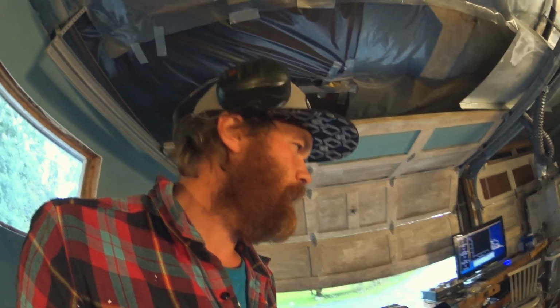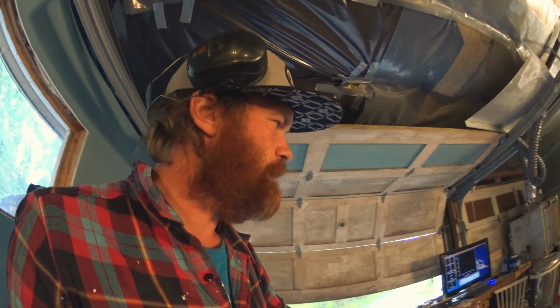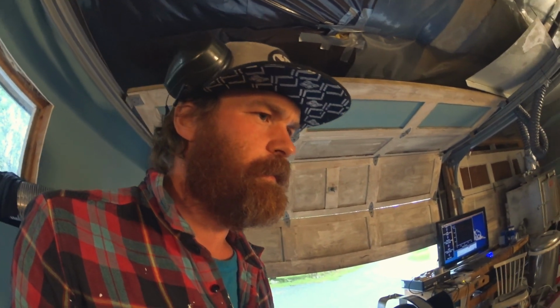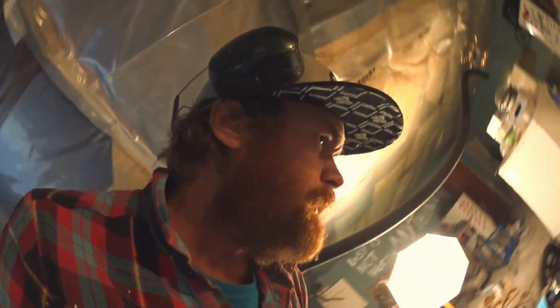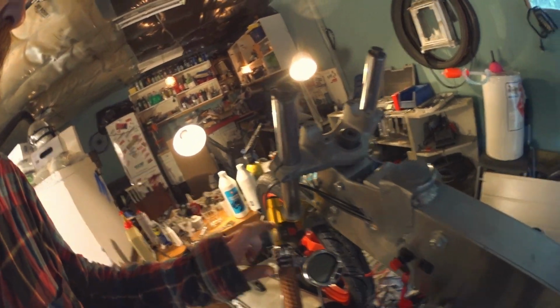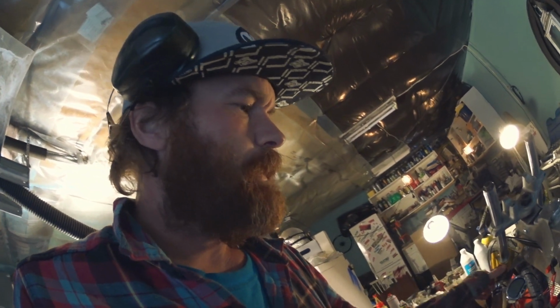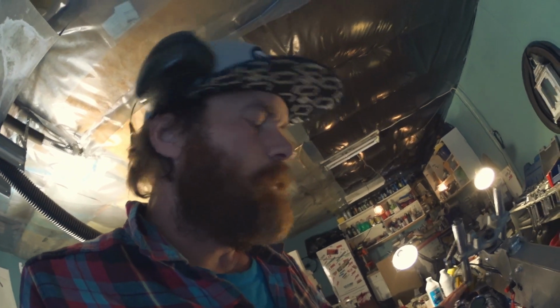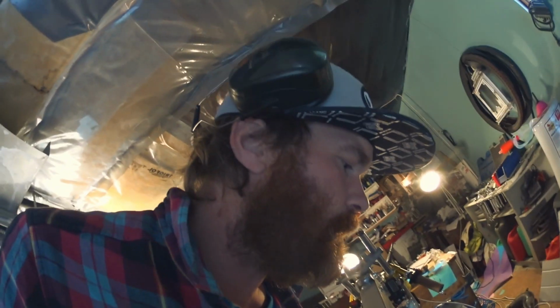Yes, I'm crossing my fingers here that it will work. It will rev and not just pop and lose and skip ignition cycles. Also, I have a feeling maybe this switch could be losing contact or switching off from vibration, so I'm going to take it off the handlebars and leave it hanging there and see. Maybe some of these solutions will help.